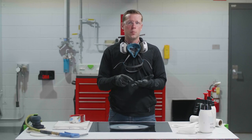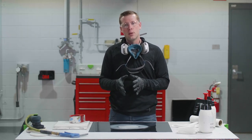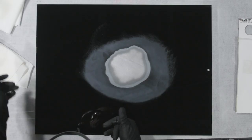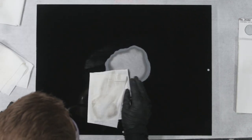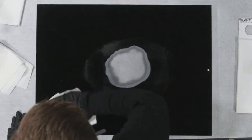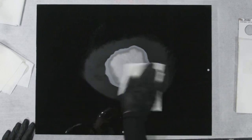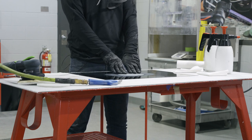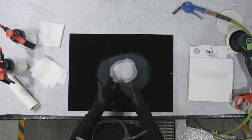Typically we would be prepping bare steel for body filler, glaze, or adhesive. Even though we used the clean and finish disc and the air blower, we're not yet ready to apply our product — we must use a solvent-based cleaner with a paper towel first. We apply our solvent-based cleaner and wipe until completely dry, flipping to fresh sides to get rid of residual. On bare steel, we want to avoid water-based cleaners so as not to introduce moisture, which could heighten the risk of flash rusting. We also want to apply the product as soon as possible, as steel can flash rust in 30 minutes in high humidity.